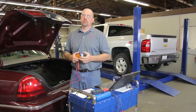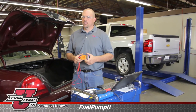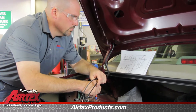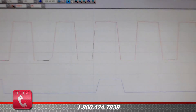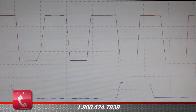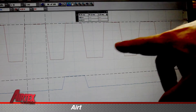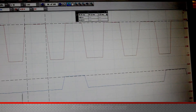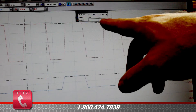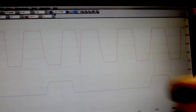Because these systems use several different duty cycle signals to control fuel pressure and delivery, a normal digital volt ohm meter is not the appropriate tool to do the electronic diagnosis. The proper tool to diagnose the driver module is a lab scope. The information we obtain by using a lab scope is invaluable in diagnosing the fuel system. Now with the vehicle running, we can monitor the signal coming from the ECM and also the signal controlling the fuel pump speed. For example, we can determine the peak voltage on the fuel pump, which we can see is 14.42 volts. We can also see the peak voltage on the signal coming from the ECM, which is 4.83 volts. We can also measure the on time in the signal, which we can see is 1.22 milliseconds. By analyzing the patterns, you're able to see irregularities that may be causing a drivability issue.